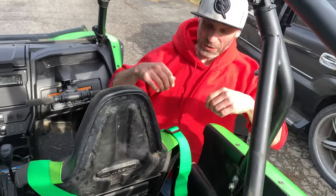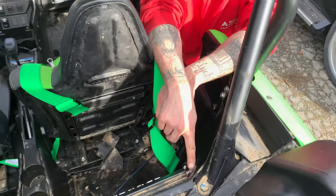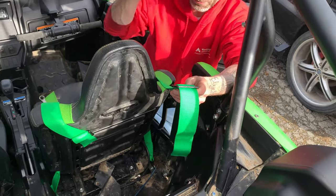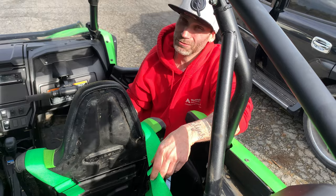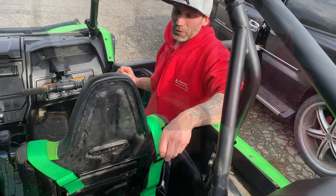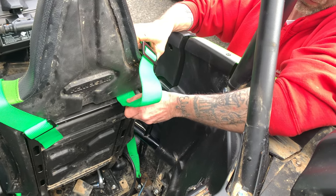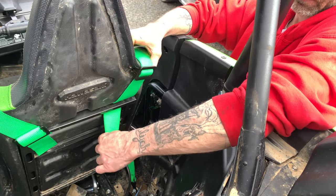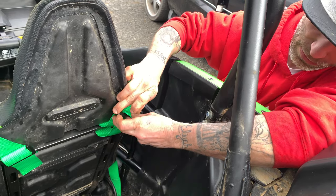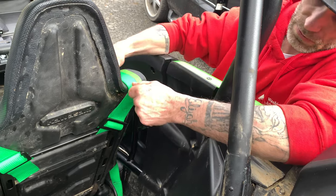On the directions, PRP recommends you mount your shoulder straps to a piece of roll bar that goes across, but our Kawasaki doesn't have one. It does have a bar underneath the plastic that runs across, but I'm not going to drill into that. So my next step - the next best option I found - I'm not suggesting anybody do it because it might not be safe - is to loosen these 10mm bolts enough to run the strap through this top post right here. Feed her through - it's enough where you can grab it from underneath, which is metal. Then put it through your harness like so and get it strapped down real good.